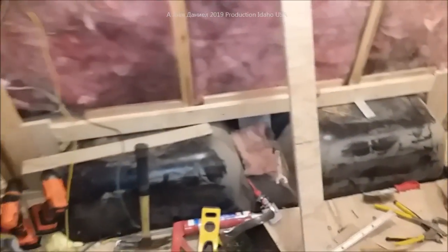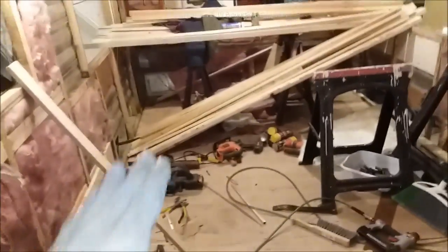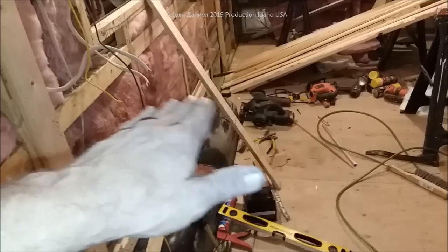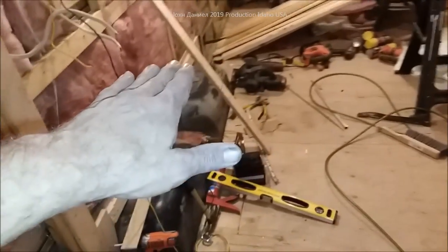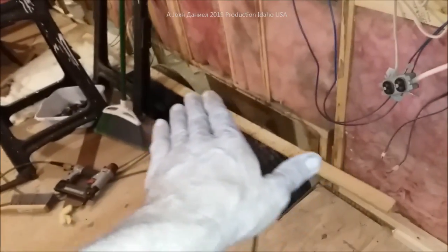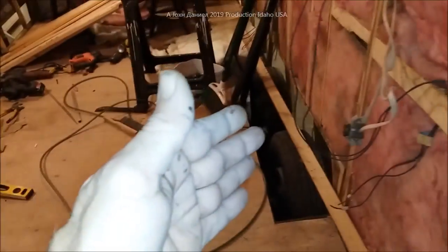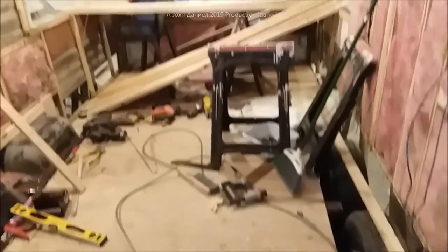And then of course the frame out for the fender, the wood structure of the fender, that's being done, and that one's just going to be a plywood because we don't have a heavy machine going on that side. And the reason is because this is the passenger side of a car or a trailer, and this is the driver's side. Now, if you've driven down the highway, you notice that on the highway, your vehicle, so that water runs off, is like that. Now, we don't want to put all that weight on this side, because if you go off on the gravel or something off the roadway, that would be not very nice. So we are having plenty of weight over here, but this fender well here is going to have that structural steel with that big metal bending unit on it. It will put 200 more pounds when we're done on this side of the trailer than that side of the trailer. Should help it track a lot nicer.